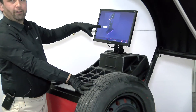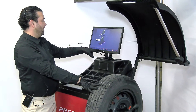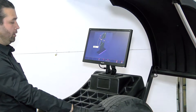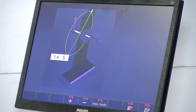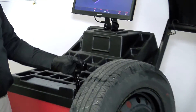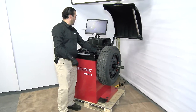If you're using a 15 inch rim, which we are here, you're going to use F4 and F5 to adjust the size of the rim. The machine is currently set for a 14 inch, so we're going to use F4 to change it to 15. Then you're going to grab the distance ruler and touch the edge of the rim.